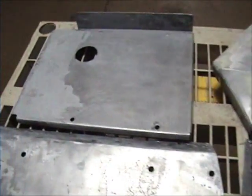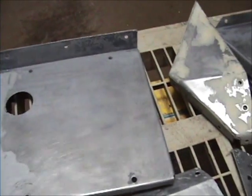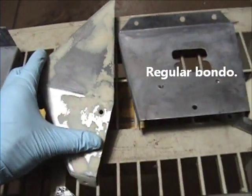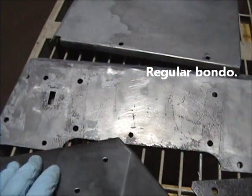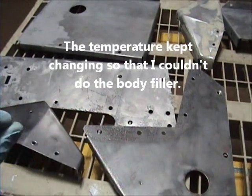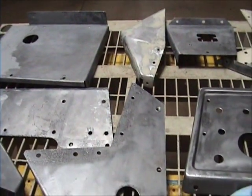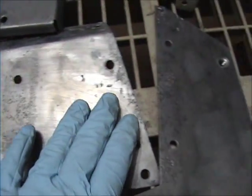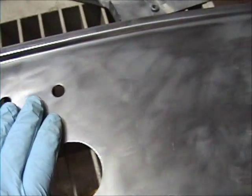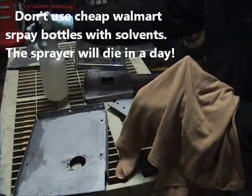Let me show you what I've been working on. I've got a little body filler on here — the All Metal — got some of it sanded down here and on the back. Now I'm going to put a little bit more body filler on these parts; I just used body filler without the All Metal since it just had slight pitting. What I did was, over the winter, I sandblasted everything again, and since I couldn't get to the body filler right away I put phosphoric acid on it with a paintbrush and wiped the excess off. It leaves a nice zinc or phosphorus coating on there so it doesn't rust the metal. The next thing is to wipe it down with wax and grease remover and then put the body filler on.